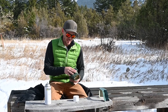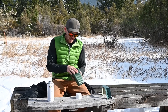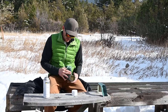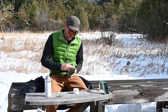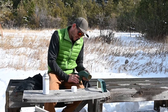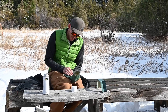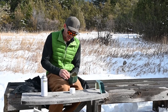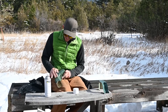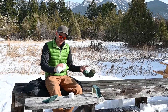Elbows are the same way. I try to sand them with the grooves of the metal so you kind of get down into those grooves and make sure everything is evenly sanded. You'll want to sand most parts for about a minute and a half to two minutes to make sure they're scuffed really well. You don't need to get all the way down to the base metal, but you want all that paint scratched up so the new paint adheres really well.